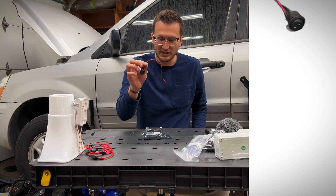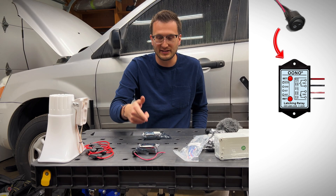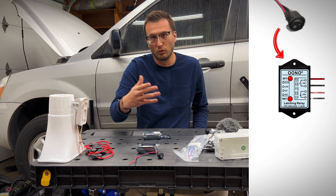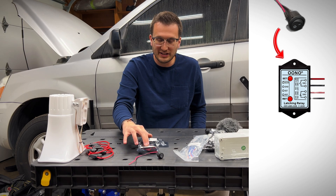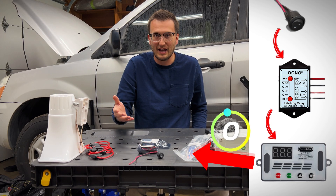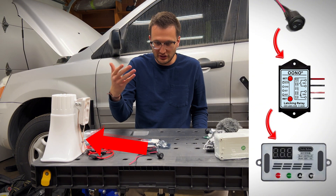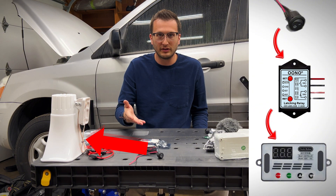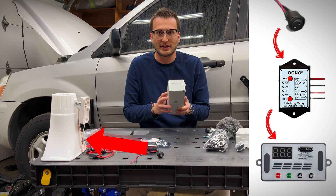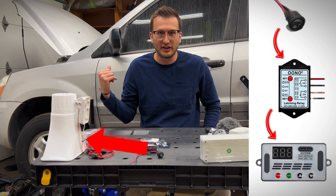Here's what I have. This switch will activate the latching relay and turn on the power — the latching relay has to come first so that if the thief starts toggling the switch on and off, the switch won't lose any power. The latching relay will provide power to the time delay, which will only provide power to the siren once the allotted time has elapsed. I'm going to run the siren through these generic relays so I'm not putting too much strain on any individual electronic component. I have this box for the latching relay and time delay to install in the cabin, and this box for the siren relay to install in the engine compartment.